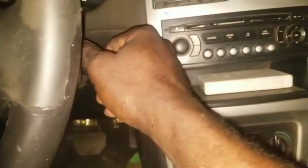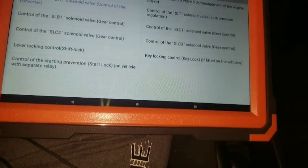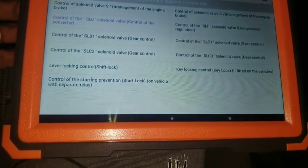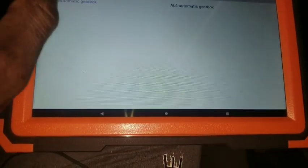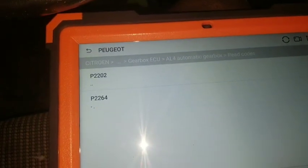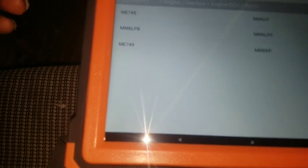Let me go ahead and start the car. She's awake - we also need to check why there's a check engine light on. It's not working. Let's go back and look for L4 gearbox - let's read code and see. We're only getting the same code here, so this might not be the L4 gearbox. Let's go back to engine ECU - petrol. I don't even know the exact variant we have here, so let's just choose randomly and see.